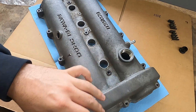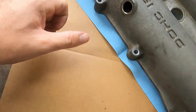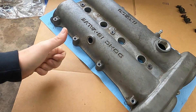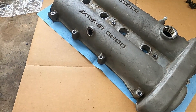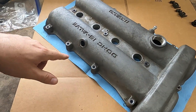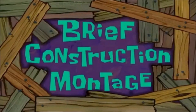The next step, like in any painting process, is going to be the prep clean. There's all sorts of junk in here — there's some oil on here, some buildup in the corners, especially back here where the cam angle sensor sits. It's pretty nasty. If we were to paint it, it would look good for maybe a week, and then the paint would just start to peel right off. So I've got some steps: the first one is a really high-strength degreaser and some water outside. I'm going to let it sit with the degreaser on it for like five minutes, spray it off, probably do that a couple times. And then I have some carbon choke cleaner or brake cleaner for the really hard-to-get spots that the degreaser doesn't affect.